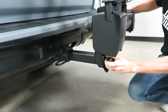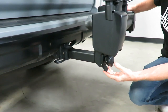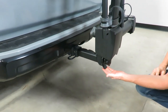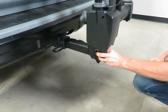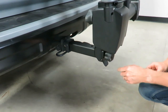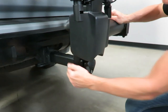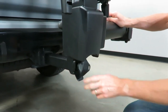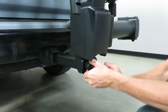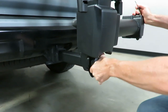Here you'll see this is a turn knob that's mainly plastic, but it's totally protected by a steel lip. So if you have low ground clearance and ever scrape it, you're going to scrape the steel before the plastic. Now I'm inserting a key into the lock, which secures the rack to the hitch. When locked, the knob just spins freely — there's no way to take it on or off. When you unlock it, you can unscrew it, take it off, or tighten it further if needed. That's how the security works for locking the rack to your hitch.